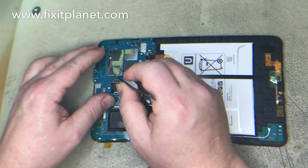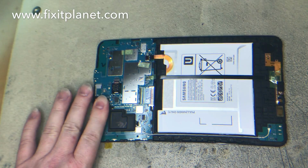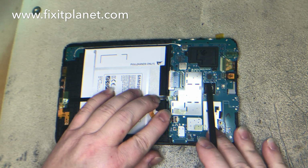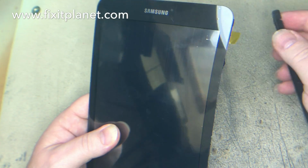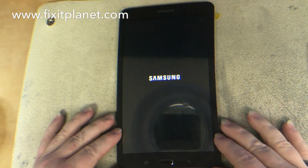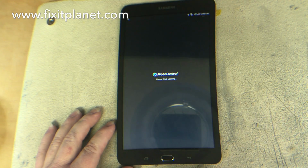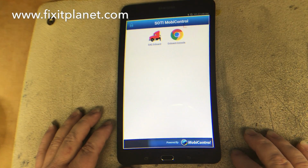Then before you go to putting that thing down and getting it crooked or anything, you'll want to make sure you test everything first, and once everything is tested and working properly, you'll be able to put the back on, and that will help you line up the digitizer perfectly. Reconnect our battery here and we'll test it out. So you won't get sound with the back off. The back needs to be on for it to get sound. External speaker is inside the back housing.